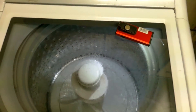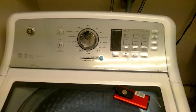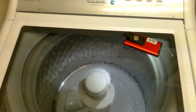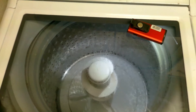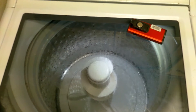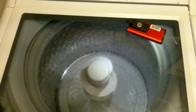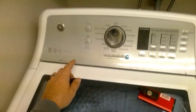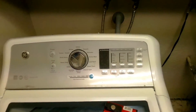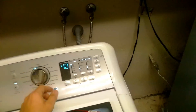So now the tub has stopped spinning and the shifter will shift it into agitation mode, and then it should start agitating. Another tip: if your tub and your agitator are kind of moving together, it means your shifter is not adjusting to point A and B — it will move a little bit, but if it's moving a lot together, it means it's not activating right. I hope this video was helpful — please like and subscribe for more future tips and videos, and have a good day.